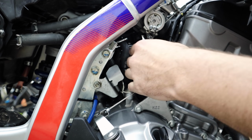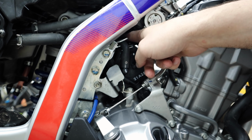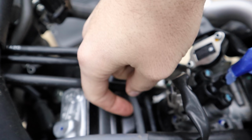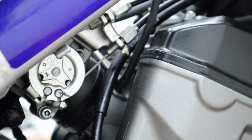Leave that tucked over here for just a moment. You may likely reuse that and connect it to the other drain that went on the other side. This hose actually wraps back around to a solenoid that sits right on top of the charcoal canister, and then comes out the other side of that canister into this pipe right here, which goes into our throttle body. We need to disconnect this one and put a nipple on it.